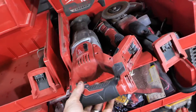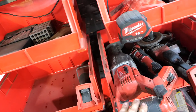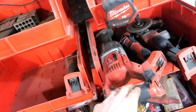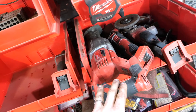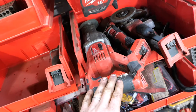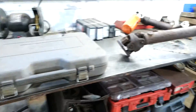The electric four-and-a-half inch grinder is definitely your solution unless you have a mini sawzall. A regular-size sawzall won't fit in the spaces you need. It might fit from underneath, but I had the engine jacked up and didn't feel comfortable being under the engine with a sawzall — there was the possibility of bumping that jack and having the engine fall a couple inches, which could pinch me or my tool. The grinder option seemed a lot softer touch and I was less physically involved inside the vehicle.